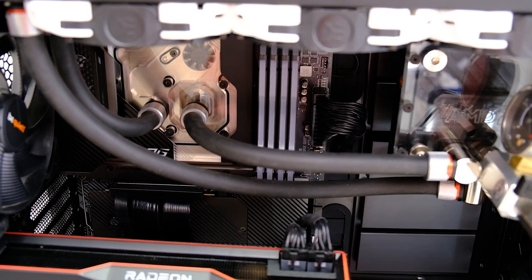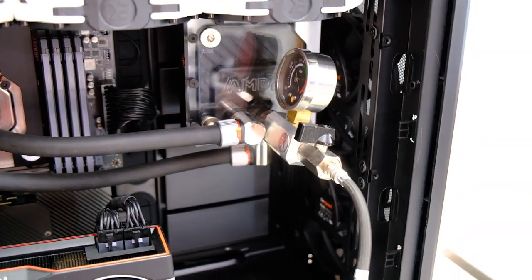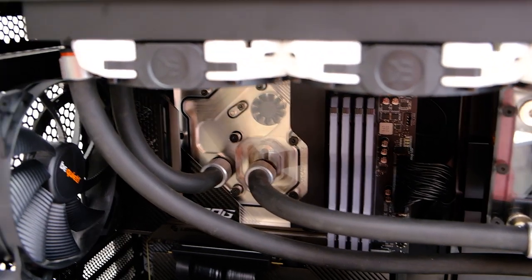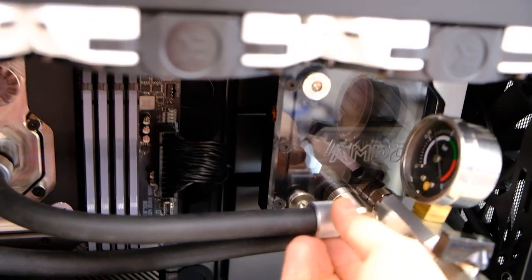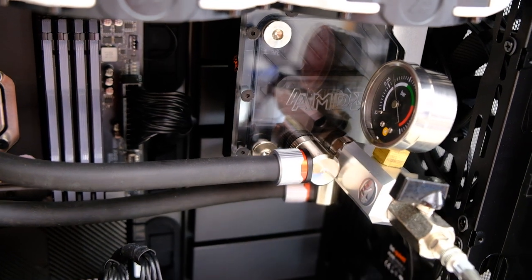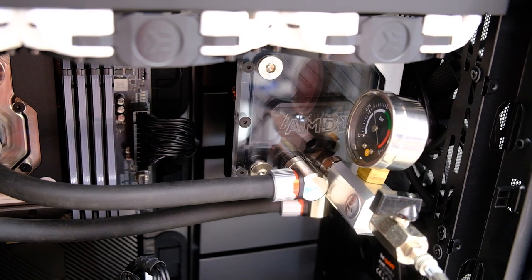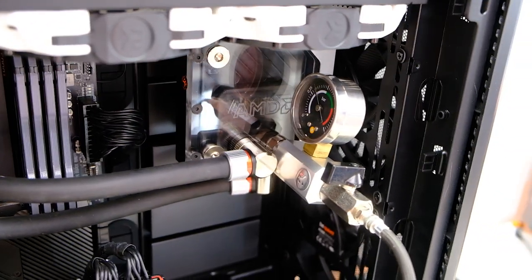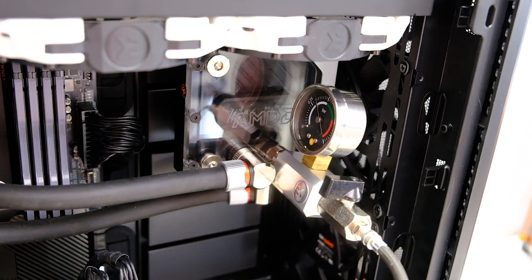And it's a really easy thing to do if you're trying to build your watercooled PC as quickly as possible, and just putting everything together. And even as you're attaching the tubing and locking off the rings that you can see here, the compression fitting locking rings, even just doing that sometimes can dislodge a fitting and basically become a potential risk if you're going to be water cooling your PC.